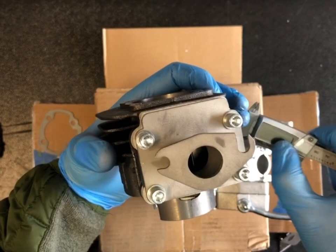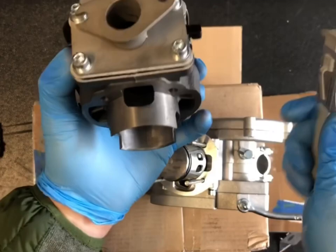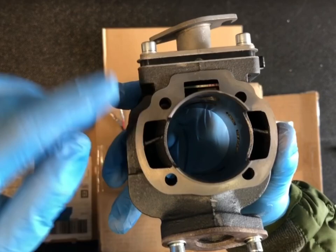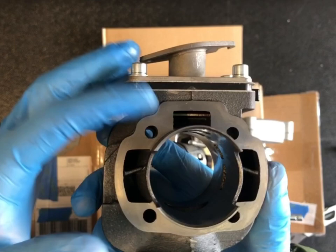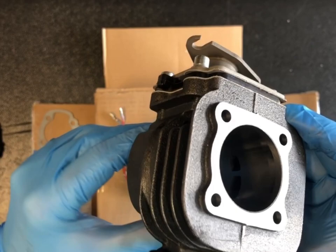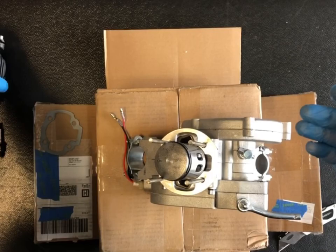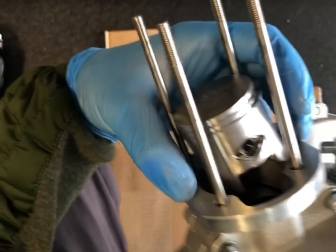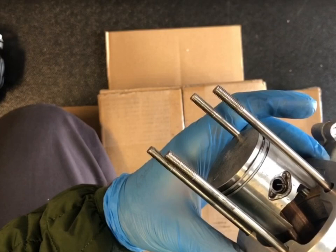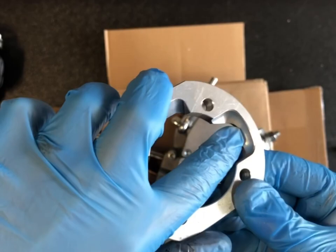Once again, nice and clean. The mouth of the intake we're looking at 21 millimeters. See those transfer ports — there's one up in front. That's where a lot of your power comes from, even with such a small cylinder. Very clean, very clean. It's sturdy, well-built — definitely not the thin alloy that the 80s and the China dolls have been coming with. That 47 millimeter piston has two rings, and there's the CNC spacer — you can see it's rigged for the transfer ports.